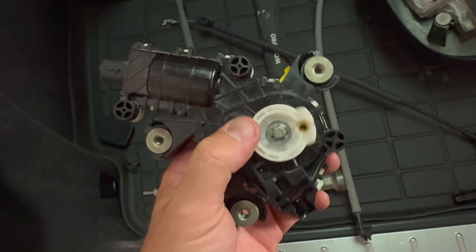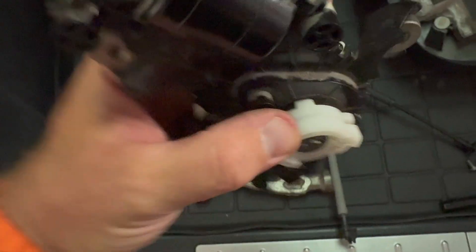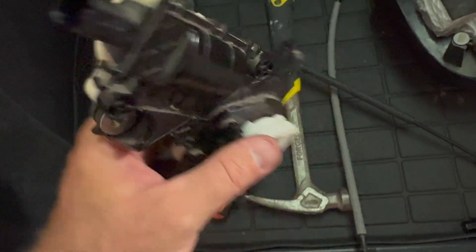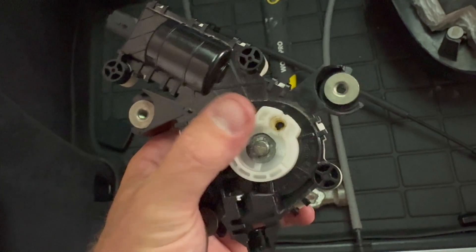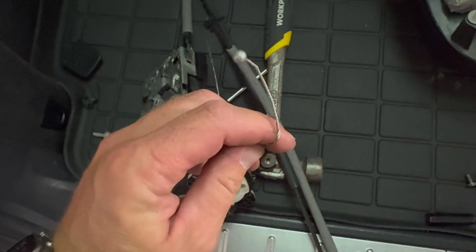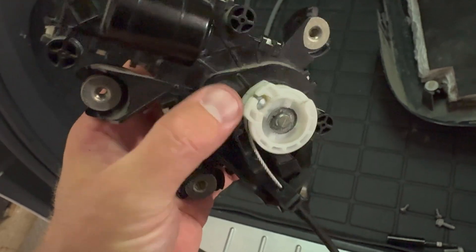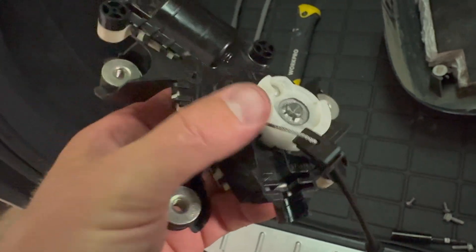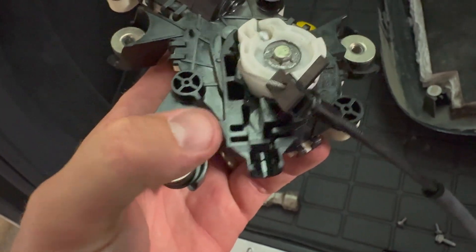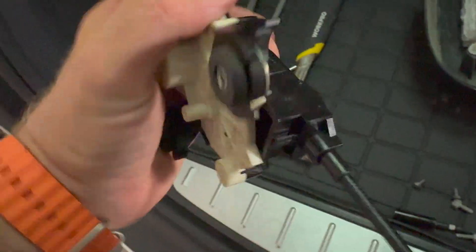This was seized — I guess it had been pulled too far, which is probably why the cable snapped. I took it apart, loosened it up, and it's working fine now. The motor spins this little cog. We're going to hook in the end of the cable — this little ball here goes in, wraps around, and then comes out the chute. Cable is routed through that groove, and this guy sits right back in here snug — it actually clicked into place with the tab on the back.